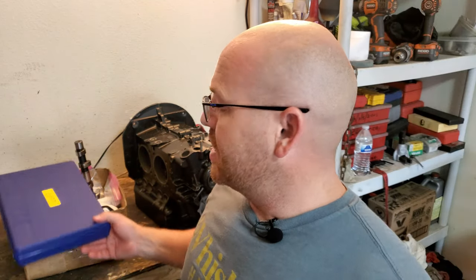What are we doing today? Well, first off, we're gonna go over some Plasti gauge. I've had some questions from one of my subscribers, Mike. Mike Hammer out there, this one's for you, buddy. The difference between micrometer and Plasti gauge and how close are they when it comes to tolerances? When it comes to blueprinting an engine or checking every single measurement on an engine, you want to use a micrometer. Using Plasti gauge doesn't count for blueprinting, but Plasti gauge is a great secondary way of checking your oil tolerances between your bearings and your journal surfaces. So we're going to check that out.